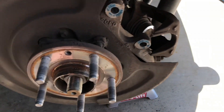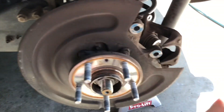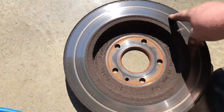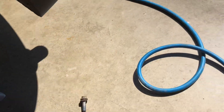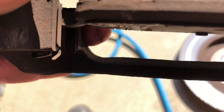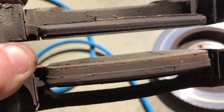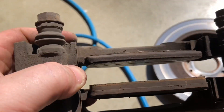It wasn't really all that rusty under here — I've seen some vehicles that get really rusty, but this one wasn't too bad. Now we can take a look at the rotor, and you can see on this side it looks like something got stuck inside of the rotor — pretty deep ring. That inside pad is done.